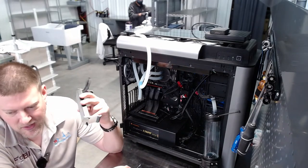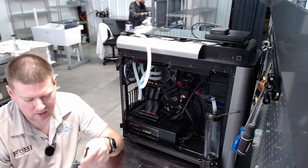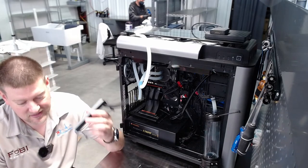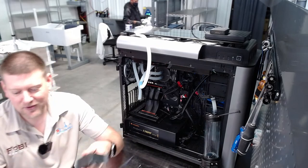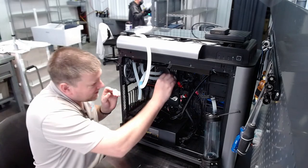But it's just so loud. And the thing is, this guy cannot be controlled by the motherboard with PWM, unlike these other fans. Maybe there's a way, but I couldn't get it to do it. Because I can't slow it down, it's always like a jet engine taking off, even when I'm trying to record audio. So I just said, you know something, the RAM's gonna have to suffer.